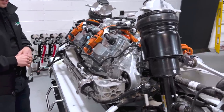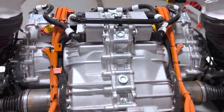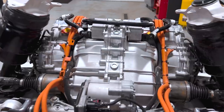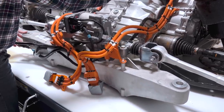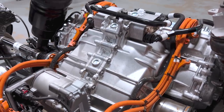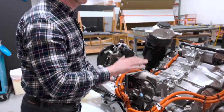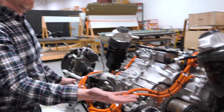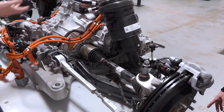Overall, this whole motor and gearbox unit is pretty massive — extremely large. But one thing that's interesting: if you remember the Model S Plaid, there was a huge girdle that ran cross-car across the cradle and captivated the top of the unit. The rear doesn't have that same packaging space. It's almost like a front cradle from the perspective of what lives on it — very few upper control arms live on a front cradle. There are no rear upper control arms here; they're mounted and still on the body, fastened to the body, and then the cradle is decked to the vehicle itself. They're using the gigacasting they bought and paid for to complement the structure of the cradle itself.